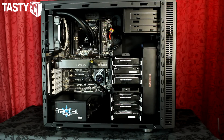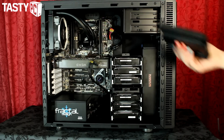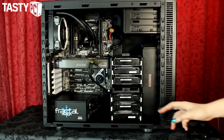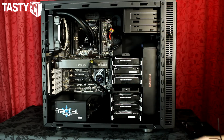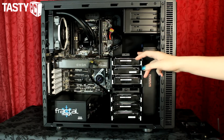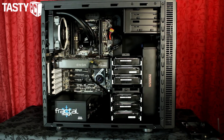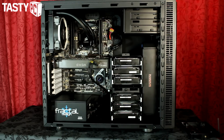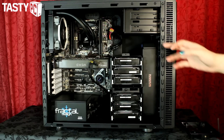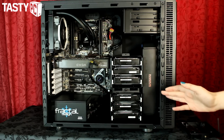So this is my first idea and it's a little unusual. I've unscrewed this plastic bit from up here because I think it looks better. I've also moved the bottom hard drive cage from here to here, securing it with two screws. This top hard drive cage is from the Fractal Design Arc Mini — I've put it in upside down because I think it looks better, although the paint finish is slightly different and it's not as straight as I'd like. Doing it like this allows me to keep all six hard drives while fitting a 60mm thick radiator in the front.